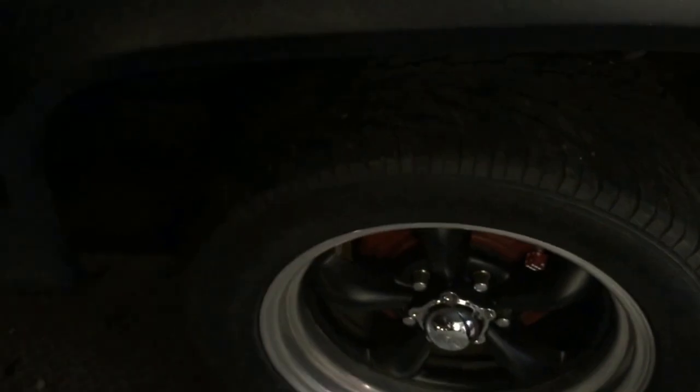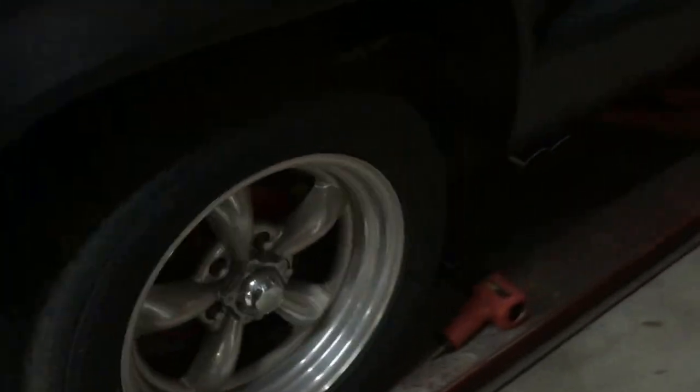I haven't decided exactly what I'm going to do yet. It does have an engine swap — unfortunately I don't have enough light on this side of the shop right now with too many cars blocking. But it has a Ramjet 350 GM Performance crate engine in it, headers, and a custom exhaust that dumps out the side here through a three-inch pipe. I'm going to make a little heat shield for it — I'll probably rivet it in since it's fiberglass, or use some kind of trick fastener with a metal backing piece.